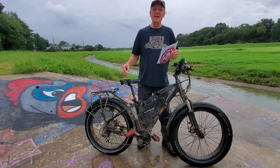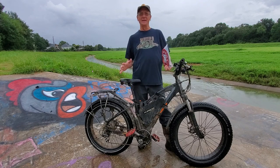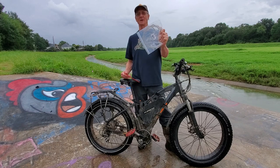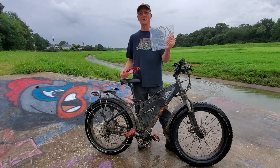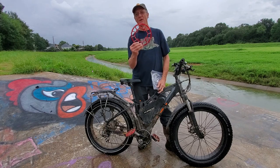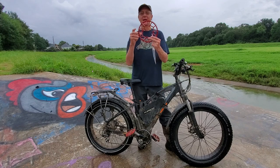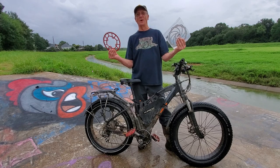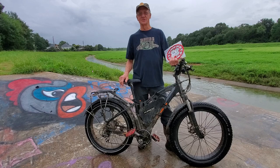Good morning. It's raining today so I can't ride, so I decided to film this video. We're going to upgrade the Rad Rover with a couple of inexpensive upgrades. One is a 203 millimeter front disc brake from the 180 millimeter front disc brake that is stock. And we're going to upgrade the front chainring from a 42 tooth to a 52 tooth chainring. Both of these are fairly inexpensive upgrades and easy to do — you don't need any special tools. So let's get started.